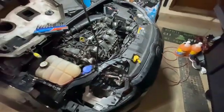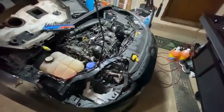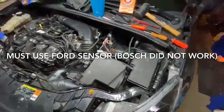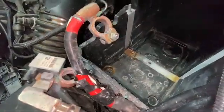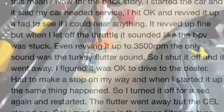And that's it — those are the three. Hit me up if you've got any questions and hopefully this clears out the code. One last thing: make sure you disconnect your battery. Always the negative side comes off first, so be careful. I took them both off because there was a ton of corrosion on these, so I poured a little baking soda on them and wiped them off really good. And I discovered that my battery terminal post is actually sticking up a little bit, and I don't like that.